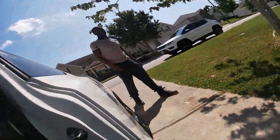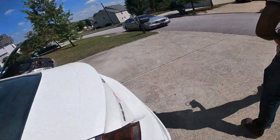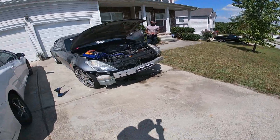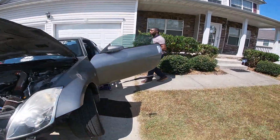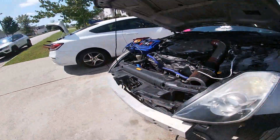I plugged the OBD2 reader into it — it's not giving me any codes, which is telling me nothing. I want to say it's not giving me codes because the car has never turned on. Also, when you remove your negative battery cable, all the codes get erased. That's where I'm at right now. I had to stop at Walmart real quick. This is where I left it. I gotta check everything that has to do with electricity — you never know how much people will mess with stuff. I got enough juice to try to crank it — let me attach it real quick.